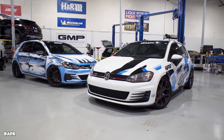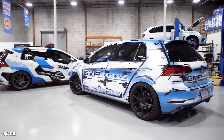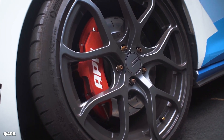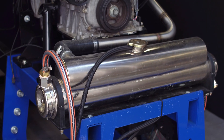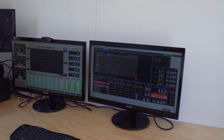Low speed pre-ignition is a known problem with small-capacity, high-boost, direct-injected engines. We've seen it on some platforms — some have problems right out of the gate, but maybe the factory isn't pushing them as hard as we are. To learn more about how it works, we bought an engine dyno and an in-cylinder pressure transducer so we could ramp up boost and ignition timing and actually see how LSPI was happening. Otherwise you're just relying on a knock sensor, which only tells you part of the equation. The team relies on these engineering tools to figure out how aggressive we can be without being risky.